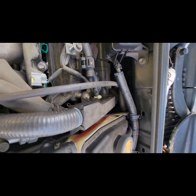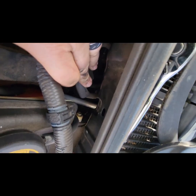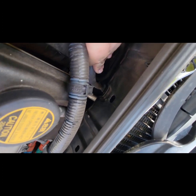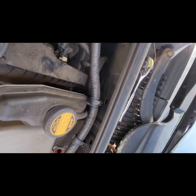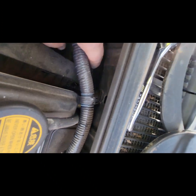When I checked the fuel rail pressure, I literally took the fuel line off — it's right back here — and I ran a fuel line through a fuel filter out here and then I had a fuel pressure tester on it. That loops back down and comes up to the fuel rail.